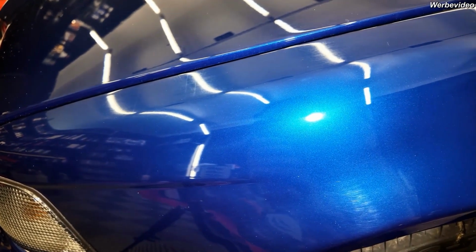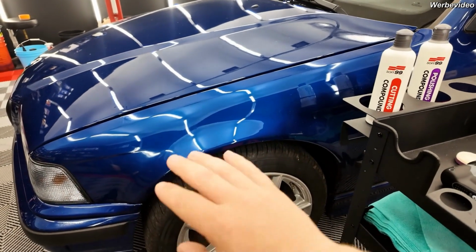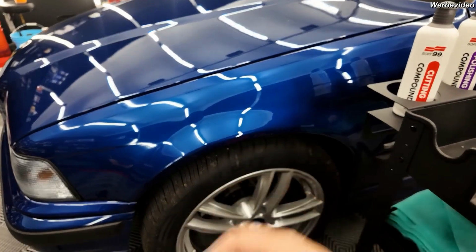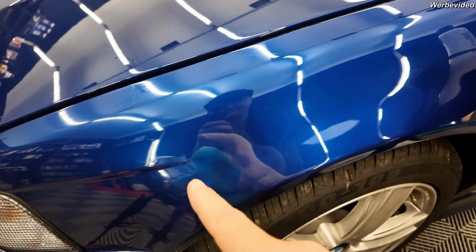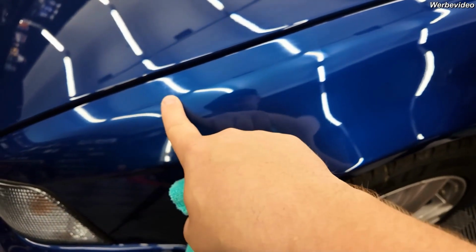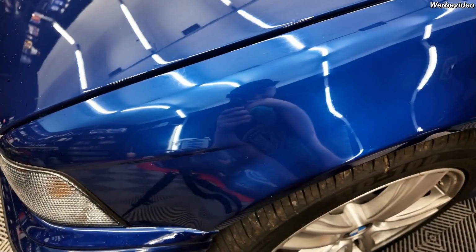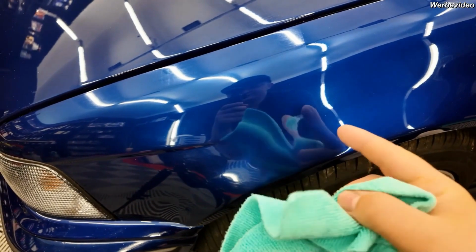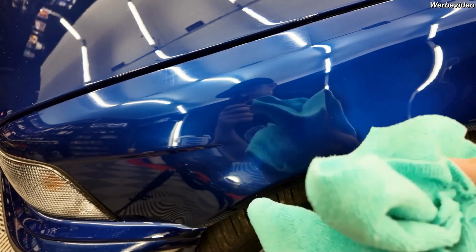What you could do now is say, okay, I will just focus on the cut for now. The holograms and small sanding marks don't interest me at all right now. What's important is that the scratches are gone. And you can already see that after you have polished out after the cut, you can tell if there are still scratches or not. For example, up here in the direct light, we will also go over the edge again because the heavy marks here are already visible with the indirect light. Very, very extreme. Let's go over it again. First, you will only make the cut, then you will switch to eccentric for the finish so that it is simply much easier. And then you can do it like this as well. So there are different options.